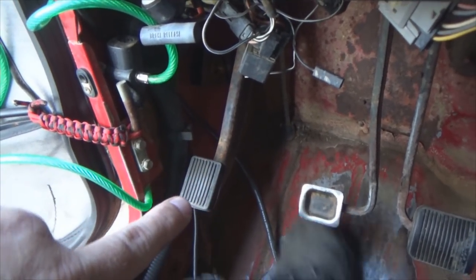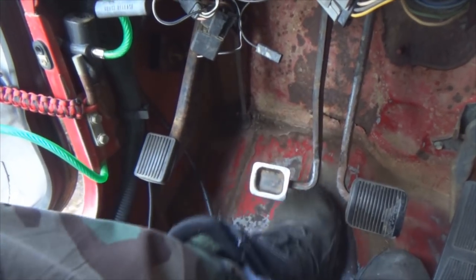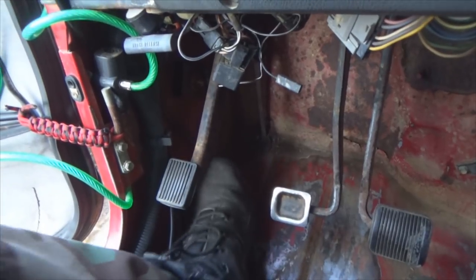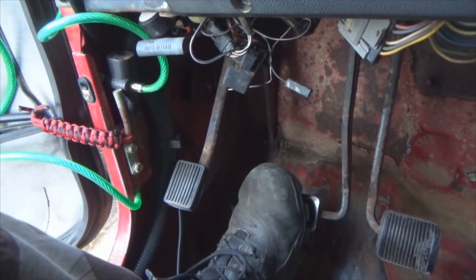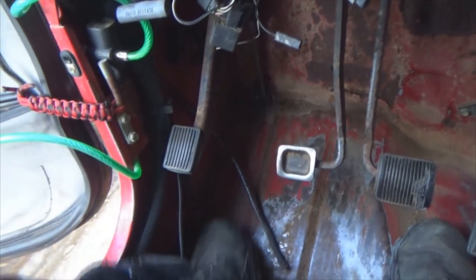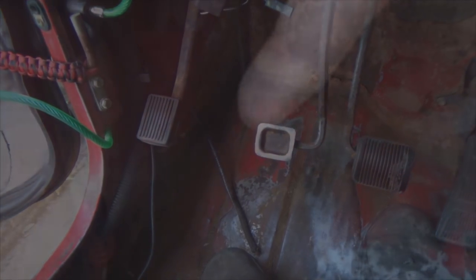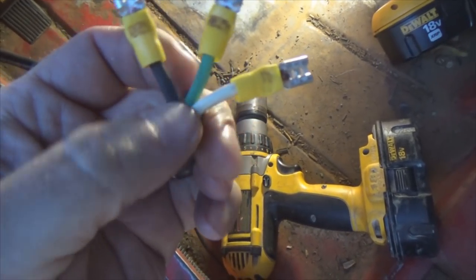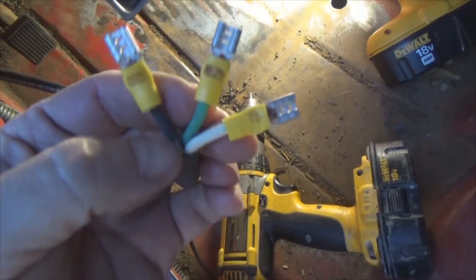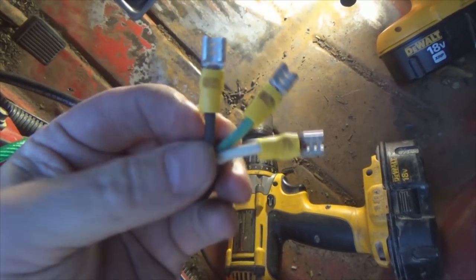I've got the wire run through the firewall, over the top of the steering column, and down this way. Now I need to find the most comfortable position to mount the switch in the floorboard — somewhere my foot naturally flows over to step on it. It looks like right where the end of my toe reaches naturally; I'll put it just to the left of that spot. I mark the center of the switch, drill the two holes, and set up the color coding: white goes directly to battery, green is the super bright, black is the daytime running light.